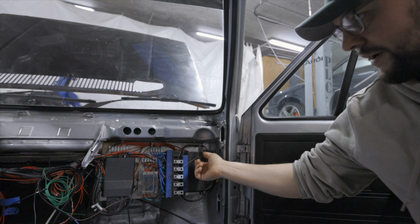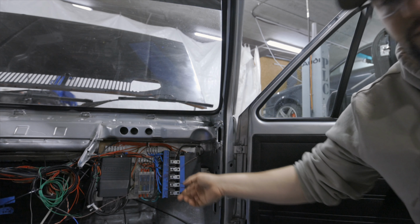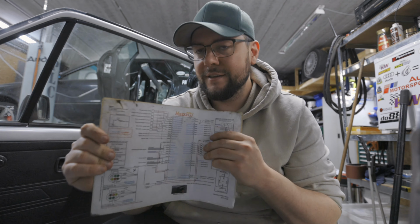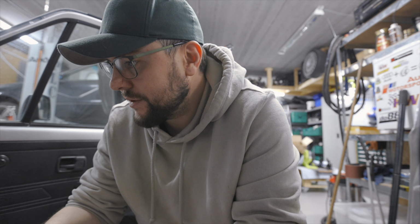Unfortunately, I do not want to test this at the moment, because there is one thing I need to wire up. See, now the ground just here. I need to wire this in, make this go to ground, because it's amazing what information you get when you actually follow some instructions. So it says this is the wiring for this ECU. This can be downloaded on the Max ECU website, and it says that digital input needs to be wired to ground.